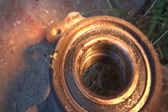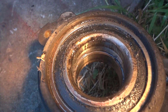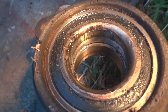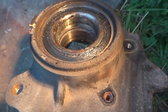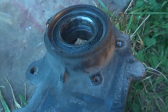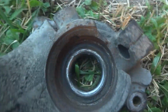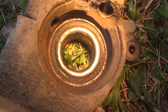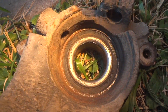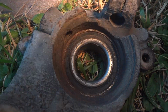You see how that is recessed down in there in that bearing, that little low place? Well, when you put that hub on, that pushes on that, and when you put the bolt in the axle, that's what keeps that bearing in there. Wow, that's crazy. I really thought we would see a clip in here, but here's the other side, and look at that. No clip whatsoever. That's just the bearing, the race. So, that's what push it out. I'm not sure which way to push it out. So, we'll go ahead and get this out, and we got it made.